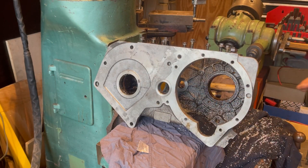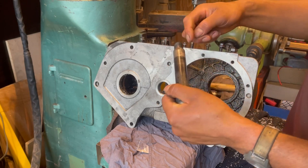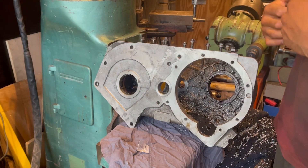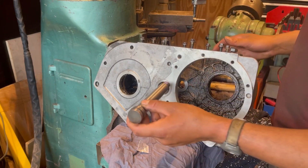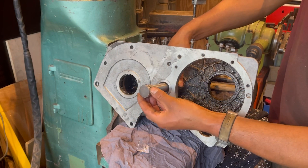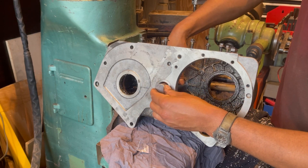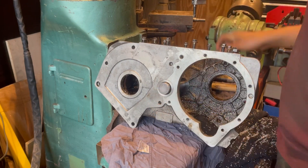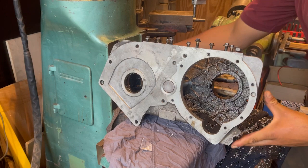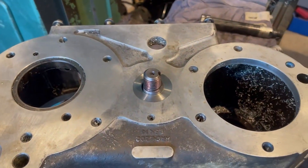It turned out that the hole had basically melted the aluminium so much that the aluminium had started to spin around the shaft. You can see on the original shaft here — this is where it was spinning in the case — it got so hot it melted the aluminium and formed itself in a new place when I stopped driving. So it appeared as if the hole I'd bored was way out of position, but where I bored was actually right and the hole that was there was completely wrong. This is the new shaft — it's 300M, heavy duty — it slides through here, it's got the seal on this end on the shaft, and on the other end the seal is in the sleeve. You can see it's a nice tight fit; you won't push it through by hand, which is exactly what you want. Nice solid job — I can't see this part of the transfer case giving us trouble ever again.